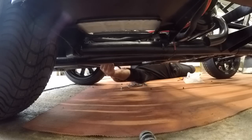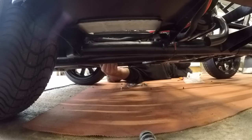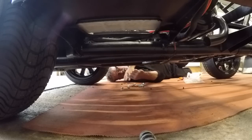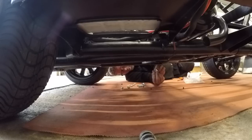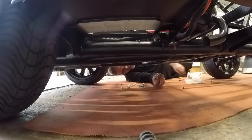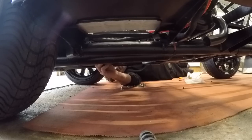They're going in nice. I pre-lined up the motor when I got home tonight so I didn't have to fool around lining it up, because it's not easy lining this motor up. I'm missing a lock nut but no need, boys, because I'm using lock washers — that'll lock her in good.